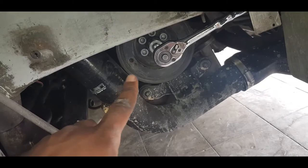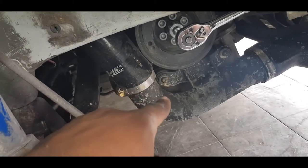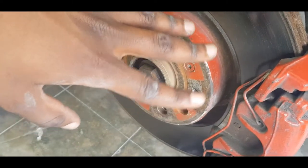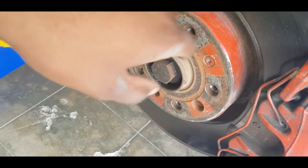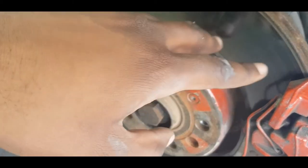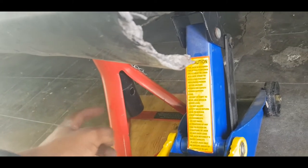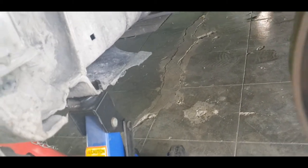And what you then do is put the other belt in its place. What I had omitted to mention is that of course you have to jack the car up and take the wheel off. Of course, loosen the wheel first. Loosen all 5 lug bolts in this case. So crack the bolts, jack the car up, then you can take the wheel off completely. Of course, never actually work under a jack. Have a jack stand, and so the car is actually resting on the jack stand here. That's this unit. Safety first. This is just here for props. As you can see, it's not even supporting the weight of the vehicle.